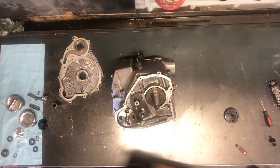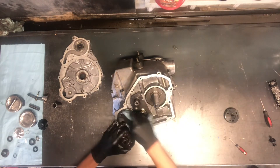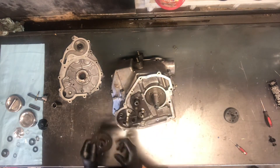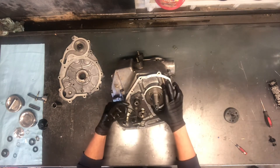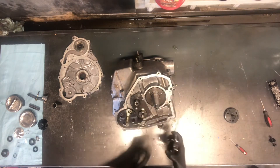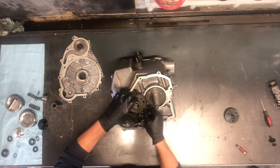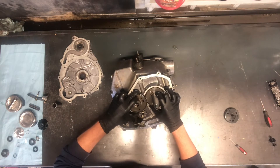It's crucial on these — you have got to have these marks lined up. There's no mark on the oil pump, which isn't always the case, so make sure your model is the same way. Some of the oil pumps have to be lined up. This is a tapered gear and there is a mark on the outside that will need to be matched up with the crank, and also the Woodruff key there needs to be matched up as well.